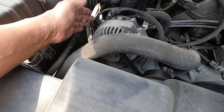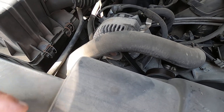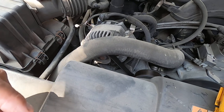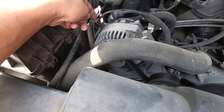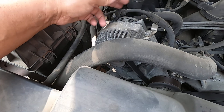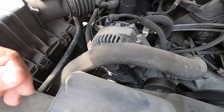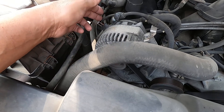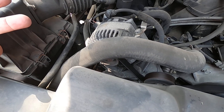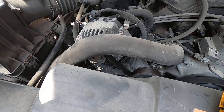Now, if I did not have input on either one of these wires, I couldn't condemn the alternator that quickly — I would have had to figure out why we're not getting our signal from the PCM, or figure out why this circuit's bad. Ford uses fusible links in both this wire and the orange wire here, according to the wiring diagram. Those fusible links could have been open, causing this alternator not to charge. So we just verified that we do have voltage at both these points, and we got our input voltage from the PCM. The alternator should be kicking on right now, and it's not — so the alternator's definitely bad.